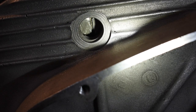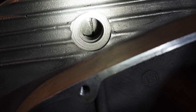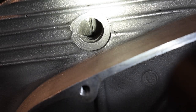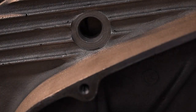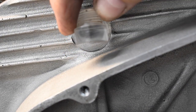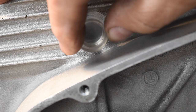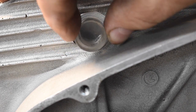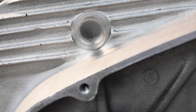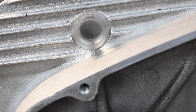If you've got a magneto, or actually any of them, and you want to dynamically test the timing, you pull that plug out, get your strobe light, and peer into the hole. You will be sprayed with oil unless you've got the little clear plug that goes in there. Here's the clear plug that enables you to view the timing mark without getting sprayed with oil. It helps if you drop some silver paint in the middle of that line, and then you can see it through the plug with the engine running — although you've got to fiddle with the angle on the strobe light to get it to illuminate it.